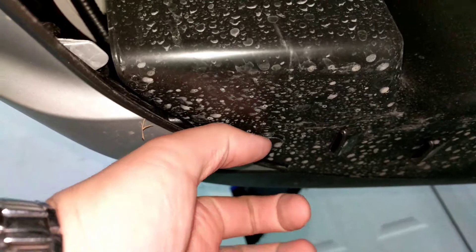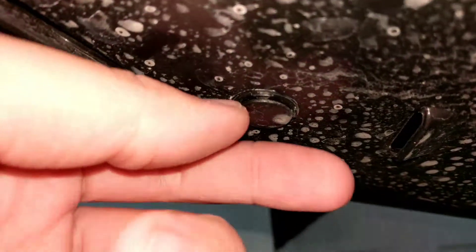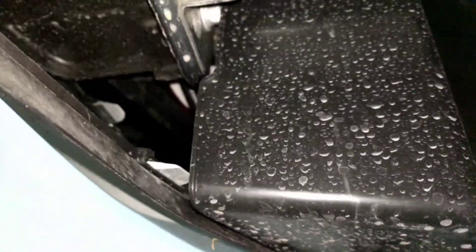We're going to go underneath on the driver's side. What you do is take a flathead and stick it in the crack here. These Hyundai clips are like a universal new car clip — you just rotate it and it pops out a little bit, then you pull the whole thing out. I did it across here, here, and then undid that one up there and that one over there, and then the panel just came out.